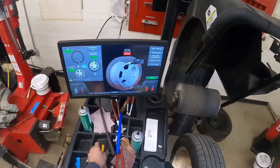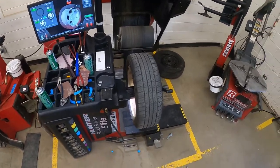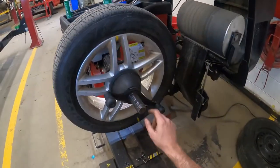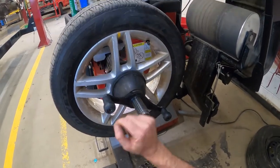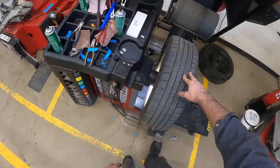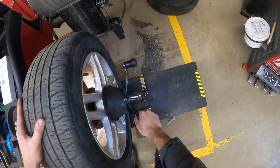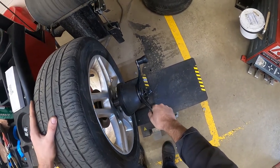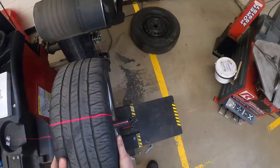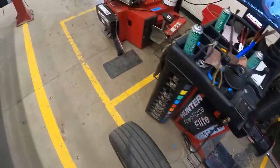The way I'm going to fix it is by going over to the tire machine and lining up the mark on the tire with the mark on the rim. So we take it off — I'm going to use my wheel lift, loosen it, double tap my lever and it'll thread off by itself, slide it off and down. Let's get to work.